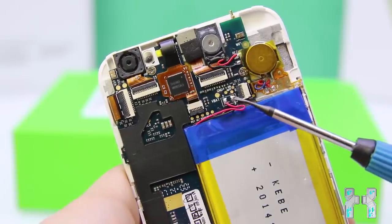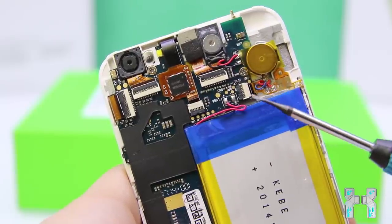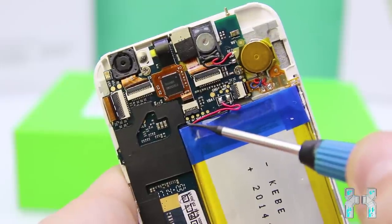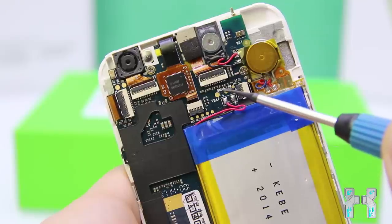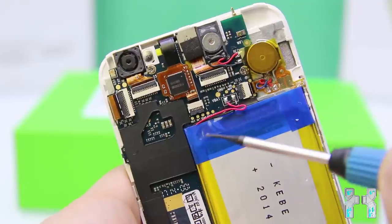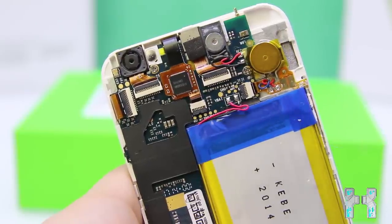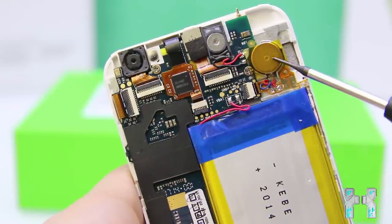Now let's have a look here at the battery contact. So here we have plus and minus. And if you can't flash your smartphone anymore, if it's bricked, try to open it up and desolder the battery. You can also try to find the reset button. And basically you have those golden pads on the mainboard and you have to ground the reset pad. That triggers META mode and makes a preloader pop up and then you can flash your smartphone again. Usually it's some of the points here, sometimes RST, but you have to try it. That depends on the mainboard layout. And don't ground plus to minus, so make sure you don't ground VBAT plus.